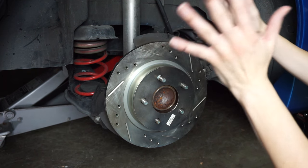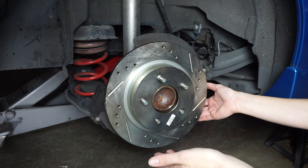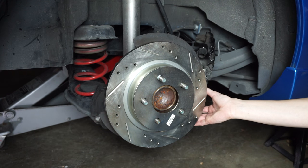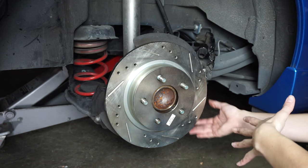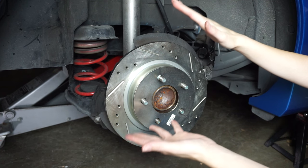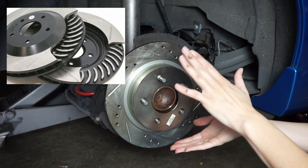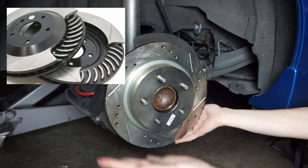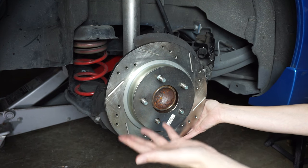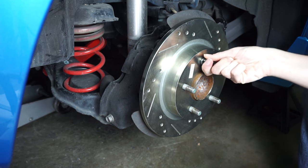We found that what might seem correct might actually be wrong. In our front rotor video we had a lot of people comment and say that we installed our rotors backwards — this in fact was not true. What some people didn't understand is that the direction of the rotor depends on the direction of the internal cooling vanes and not the outside slots. There are clear markers on the rotor indicating on which side it's supposed to be placed, and that's the procedure we followed. So please follow the indicators for your specific vehicle as well. While you're working you can put a lug nut on your rotor just so it doesn't move around too much.